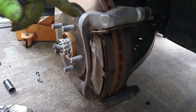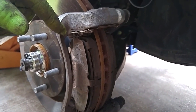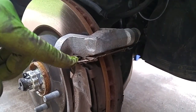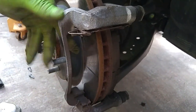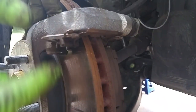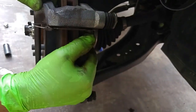What's unique about this Nissan's brake system are these abutment clips. It's spring-loaded at each corner, so each abutment clip has two springs. It's a pretty clever design — non-conventional, in my opinion, at least not yet — where each corner has a spring to push the pad back out after you release pressure on the brake pedal.